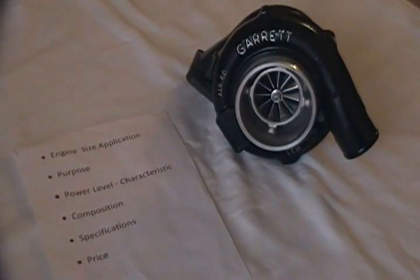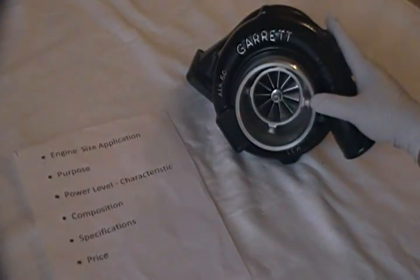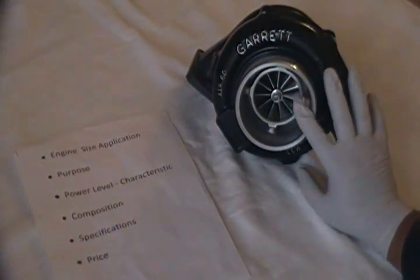Power level characteristics — it's extremely responsive, utilizing the turbine wheel of the standard 3076R. This did not change when switching between the GT3076R and the GTX 3076R. It uses the same 60mm exhaust wheel. The compressor wheel itself is created for high rotational speeds for upper end power to completely flow this exhaust wheel by using an 11-bladed design.